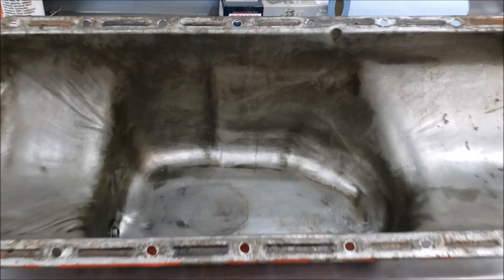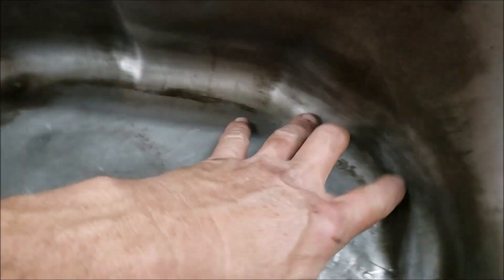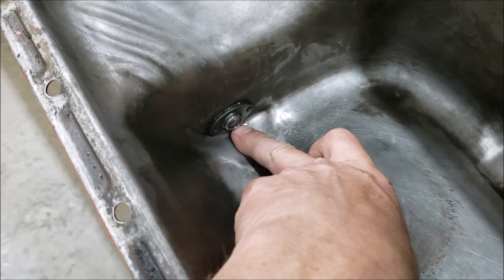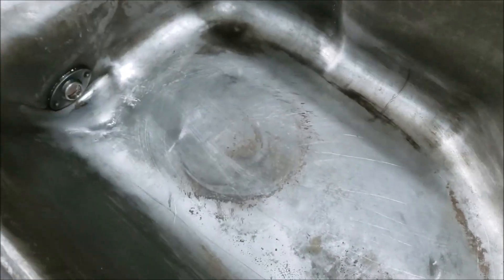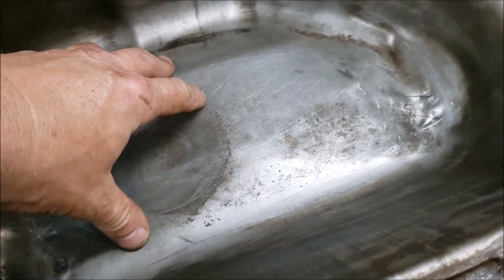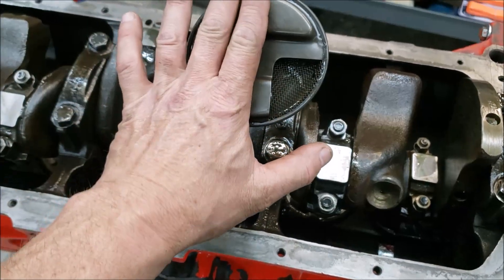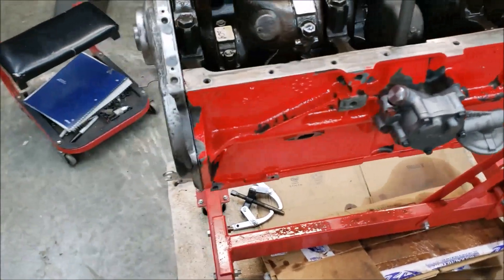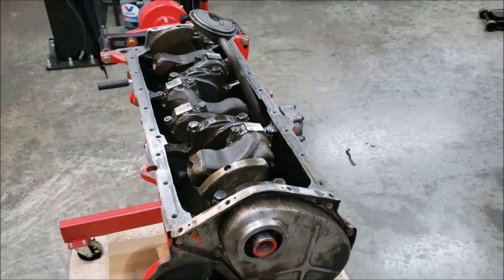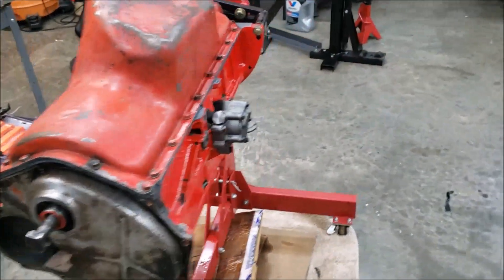Next up, the oil pan. There were some pretty decent dents in here, so I hammered them all back out with a ball-peen, got it as flat as possible. This is why you've got to change your oil often - you've got about a half inch before the actual bottom of the pan, so a lot of sludge builds up in here. You can see where the old pickup was. Always keep this thing as clean as possible. I got the screen on, already checked it for height. I always bend them out slightly so I can feel them and then tap them back, check with a little clay, and go from there. Oil pump and timing cover are on. We're gonna finish up the bottom, clean it up, and then spray-paint it.